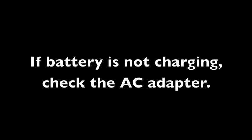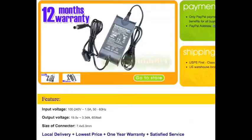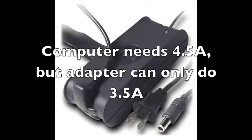Now, if the battery's not charging, let's try to rule out some other things first. It could be a bad power adapter, bad AC adapter. If somebody's using an AC adapter that didn't come with that computer, it might not be putting out enough amps or enough wattage to actually charge the battery, and I've seen Dells do this. For example, I've seen power adapters that appear to be correct for Dell computers, but they're a little small actually, and they don't put out the correct amperage. They put out too low of a current, and therefore, though the adapter powers on the Dell computer, it won't charge the battery, and usually you'll get an error message when you boot up